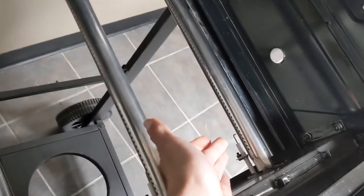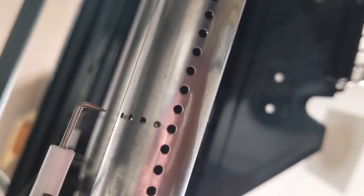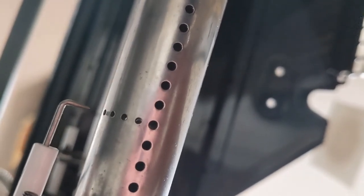I wanted to show you in this really clean burner where stuff is easy to see. I don't have any gas attached to this grill — so this is not an unsafe practice, and I am inside. But watch this. Do you see the spark? That is what it looks like when it's operating correctly. If there was gas running through this burner, enough would be coming out that it would actually light. You can see that the electrode is lined up directly with that line of holes that goes across the bottom of the burner — those holes exist for ignition purposes only. I bet you didn't know that before.